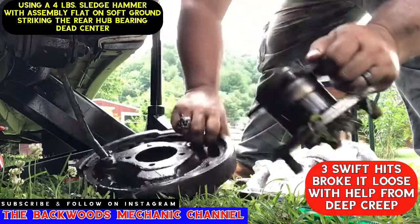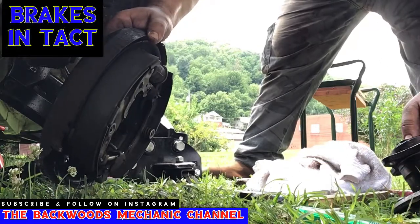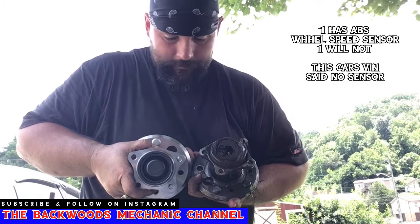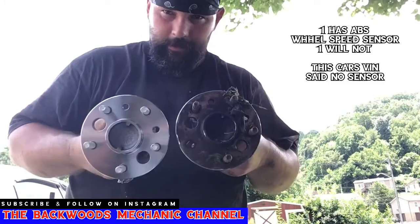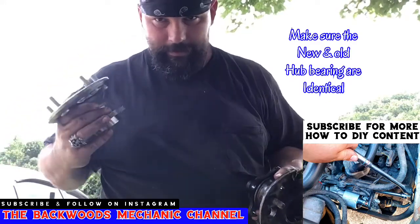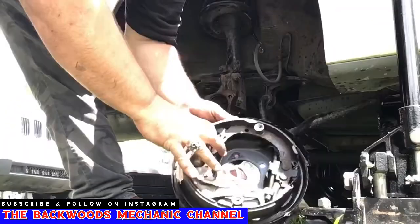Here's the old one, and all of the brakes are still intact. One will have the wheel speed sensor, one will not. Considering this one's not hooked up, we're just going to go ahead and put this one back in its place. Both of them are identical, have the same threads, the whole nine yards. So now we're going to clean up that flange and we're going to reinstall it. So we're going to go ahead and flip this over.